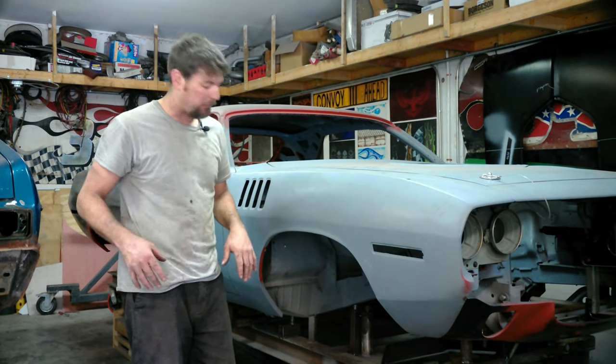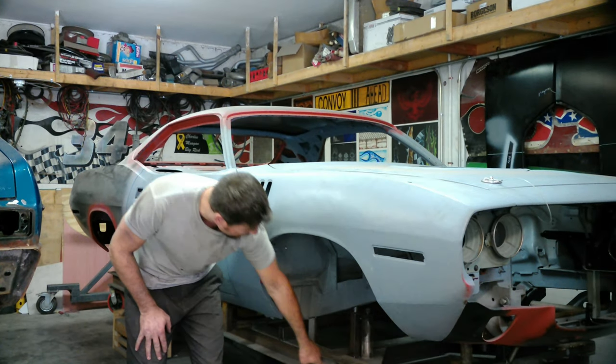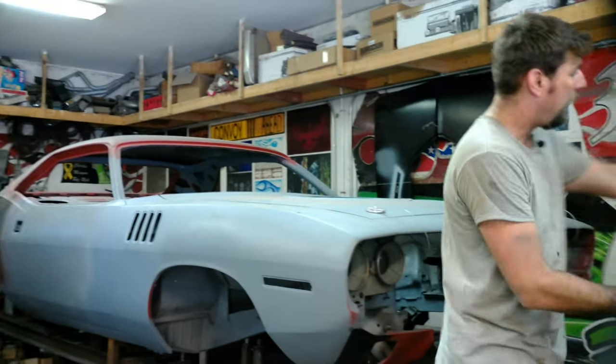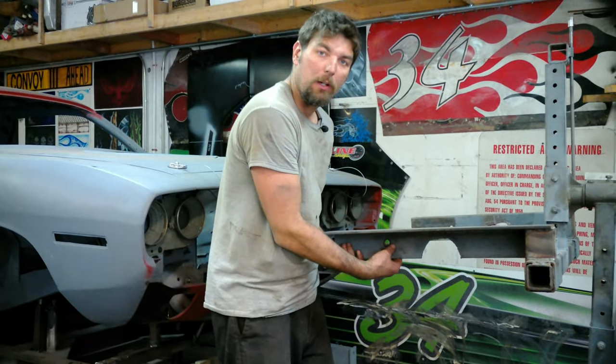It'll go about the same height as the rotisserie. We're gonna walk this up with trailer jacks, get it at height, then slide the front mount in — using the bumper bolts in the front. We moved away from the shackle mounts in the back because I want the rear valance accessible for bodywork, so we're making new mounts on the bumper bolts.